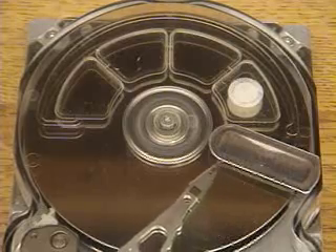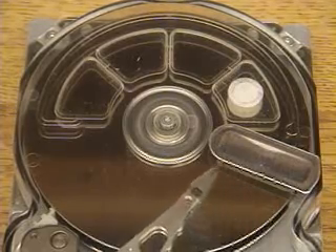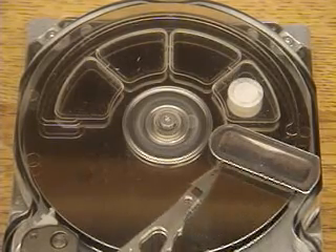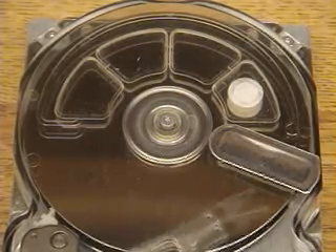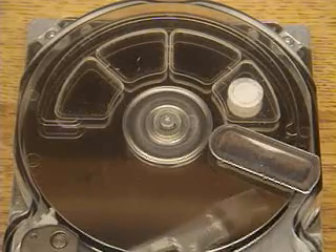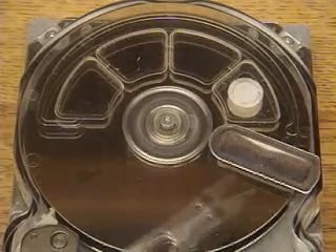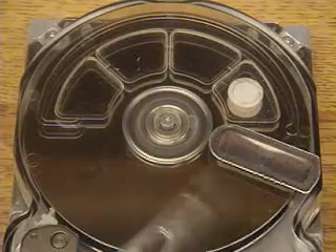As it does this motion it looks kind of continuous, but it's not. It's actually moving from one specific track to another — jumping, I think we're up to 32 or 64 tracks at a time on each sweep. Now it's actually moving half its full distance per given seek, moving to three specific locations, locking on and then moving back. It happens too fast to really see — you just sort of see a ghost image of three servo arms. It's really rapidly locking on track.